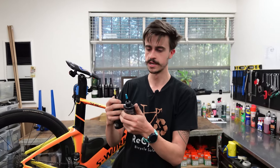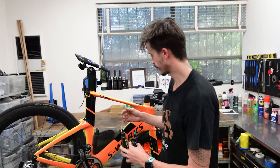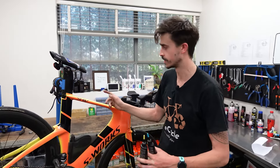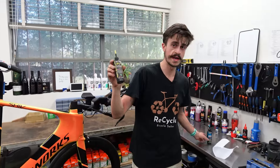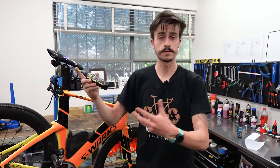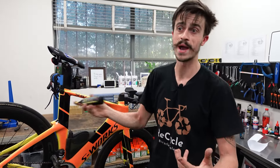Or they just over-lube it. For wet lube you want to reapply around every 400 kilometers — if people are doing it every couple of rides, that's too much. For this bike — a triathlon bike with a race coming up — the dry lubricant is the right choice, so let me put some on and show you how I do it.